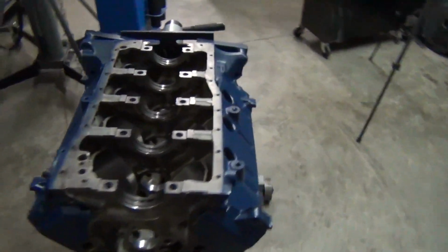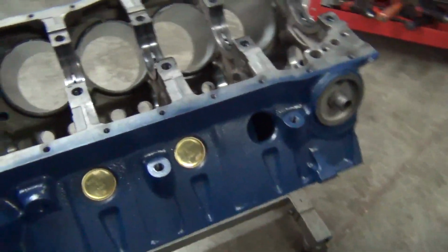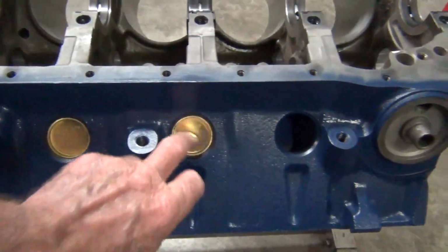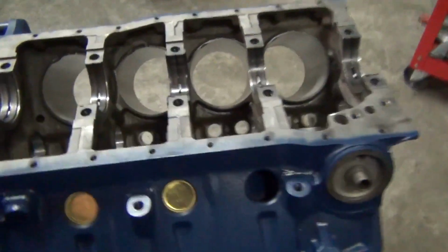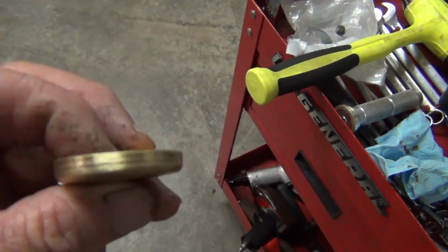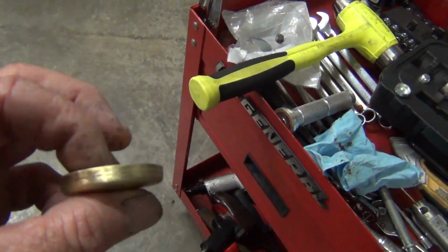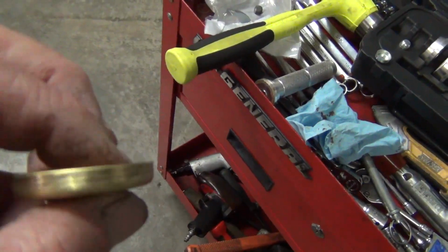And yeah, I'm gonna go ahead and get these freeze plugs in, because I'll show you how we do it. Pretty simple. I'm sure you guys have probably done this before, but I like using the brass ones. I just think they look nice, especially against a painted block. I've already got two of them set in there. So what you want to do when you do these freeze plugs, it's better to sand them just a little bit around the edge with a very light emery cloth. That just puts a little bit of scratches on it. Not bad at all, just a little bit.